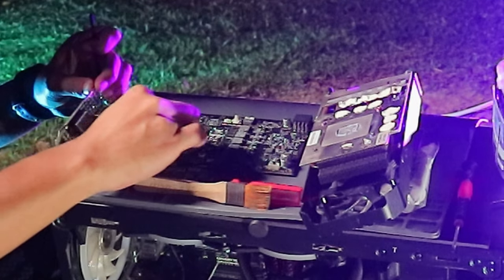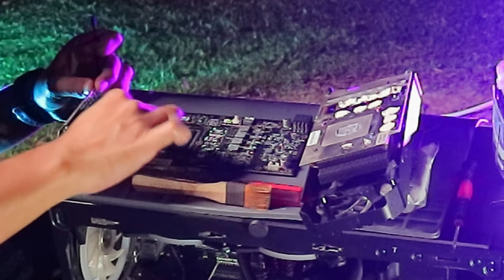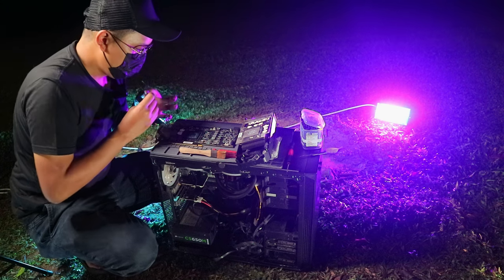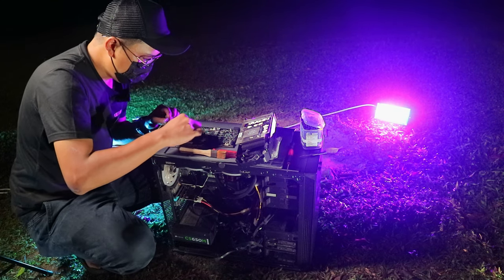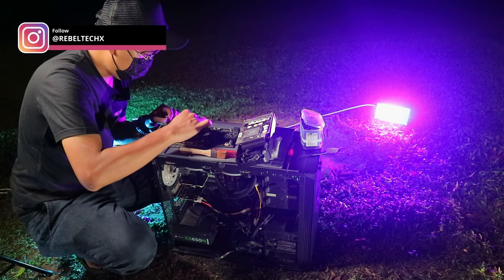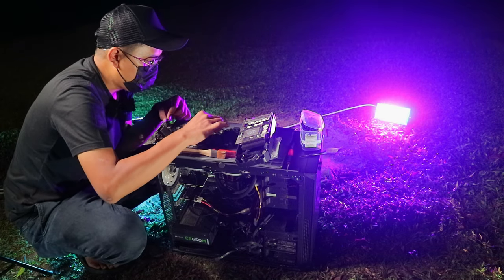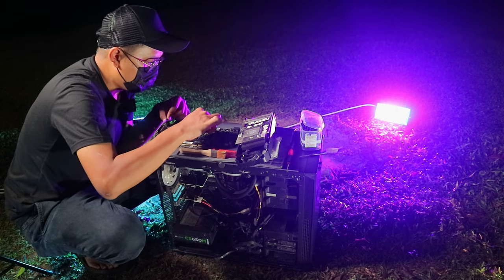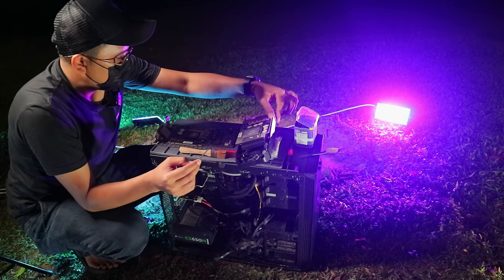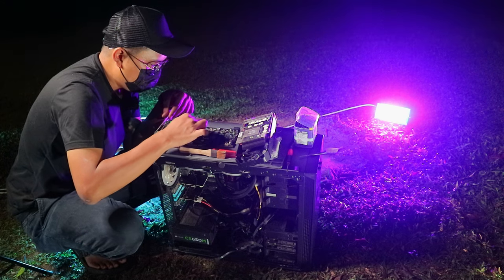You can do this on your own, guys — you don't even need anyone. You don't even need to send it to the shop, unless you're rich. It's not the most perfect but it should be fine. So this is the VRAM — I don't prefer to use normal thermal pads for this. I'll still re-use the K5 Pro pads — one year and they're still fine. I'm just gonna reapply.